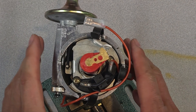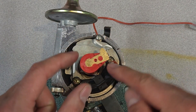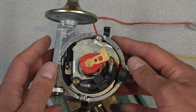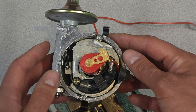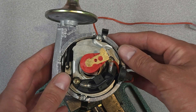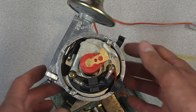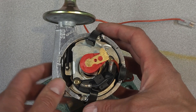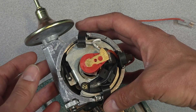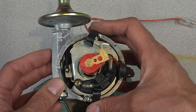I'd like to discuss terminology regarding distributor motions. The direction of rotation is noted here on the arrow — when the engine is running, the distributor rotor rotates in this direction. If you're measuring zero degrees at idle and want to be around 10 degrees, you need to add timing by rotating the distributor body clockwise to advance. Conversely, rotating the body counterclockwise will retard the timing.